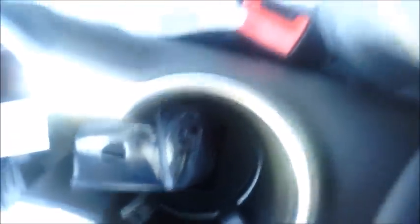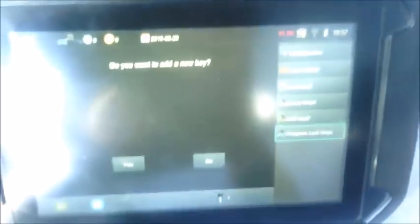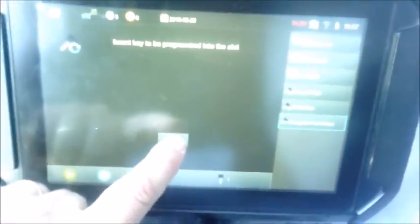Keys have been cleared. Insert a key to be programmed into the slot — I've got my first key in the slot, buttons forward, making sure it's all the way down. Hit OK. You can see on the bottom of the screen you have zero keys programmed right now — that will change to one after I hit OK and the lock cycle programs the first key. Done. Do I want to add a new key? Yes, because I need a second one. I'm going to take this one out, put my second key into the slot, and hit yes. Insert key to be programmed — I've already done that. Hit OK for our lock cycle. We now have two keys programmed.